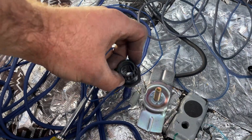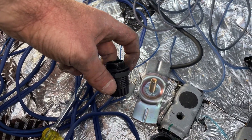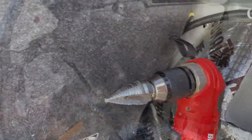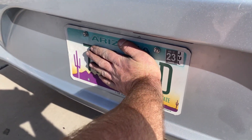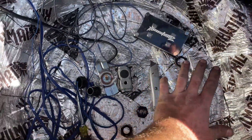If you're going to run big power wire, you've got to run it under the car. There's no way you're getting three or four runs of 1/0 — well, 4/0 in my case — through the car interior. What we've done is use the spare tire compartment. You can see I've got grommets going through right there, using my step bit to drill those holes. Then they all come right out from behind the license plate cover, so it'll be a pretty easy place to snake big power wires right in and out, and my LTO bank will be right here.